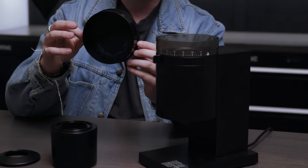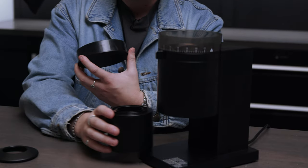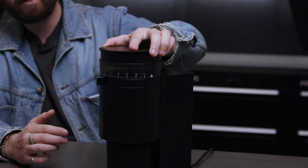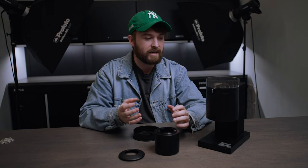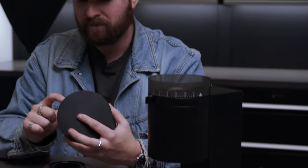First things first, you have the actual hopper lid here, which uniquely — I don't know if they intended this — but from a machining tolerance perspective, this actually does create a good vacuum when you place it in the hopper. This is really important to get all of the retained coffee grounds out of your burr set, so the next shot of espresso you get is not going to include what was in there a week ago. That tolerance is nice, but even after about 100 times putting this hopper on, we do have a good bit of scoring on the inside. So being plastic, you are going to experience a good deal of wear.